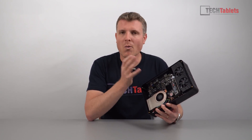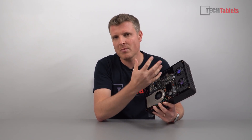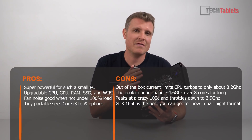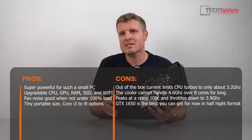What gets really hot inside is the chipset, but it does have a heatsink on it, which is good. The graphics card gets up to about 75-76 degrees max — also acceptable. My Samsung SSD is actually getting very hot though. There's the possibility of running a system fan — something like a 100mm fan at low RPM — to help cool the internal components a bit more. We're basically talking about a gaming notebook cooler with two heat pipes trying to cool a 65-watt processor when it was designed for 45 watts max. I went for the eight-core version to see the worst-case scenario, and I can now see you'll probably want to stick to the Core i7 or Core i5 models, which are cheaper.